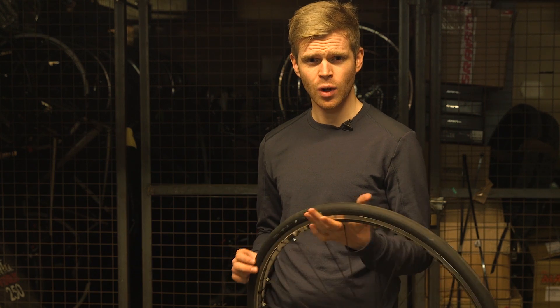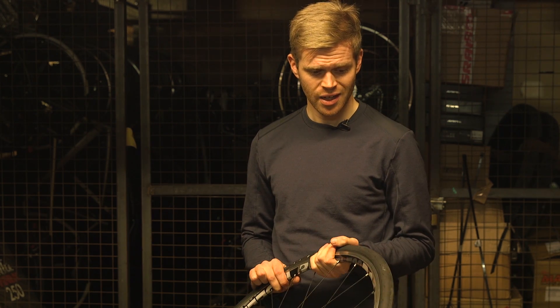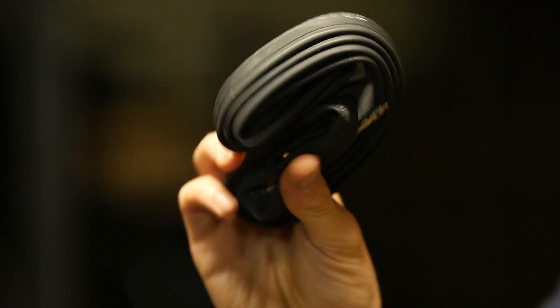I was not expecting it to survive a nail being driven through the tire carcass. You could easily ride home on this tire even with the air that's been lost, and you could always top it up with your mini pump as well. It's a win for the tubeless tire. If you're running tubeless, your chances of punctures is much, much less, but you can still get a puncture, and sometimes the hole will be too big for the sealant to seal it. If that happens, it's not the end of the world because you can actually put a piece of old tire inside your tire to cover a big hole, and then put a regular inner tube inside and pump it up as normal.